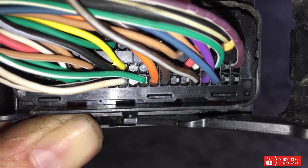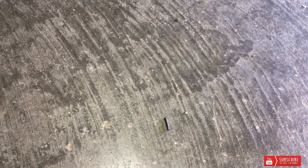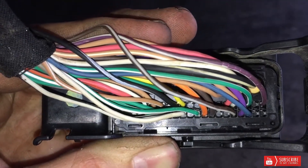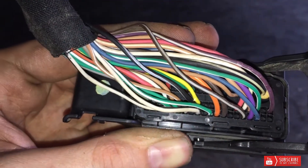When you do that, look right there on the links to the yellow on the right — you'll see that's got a blank in there. Basically that blank is the one you've got to knock out. To do that you need to get a small pin or needle, come through the back side of the connector and poke it through to pop that out. When you do that it'll open up that hole and you just slide that wire right in — it clips, no big deal.